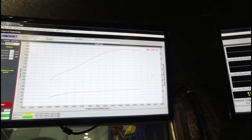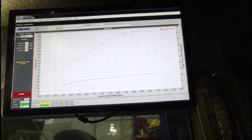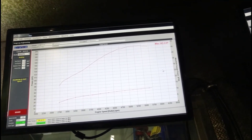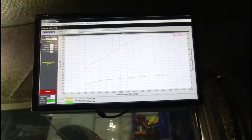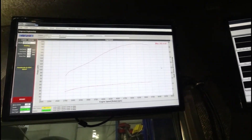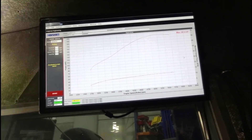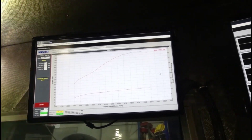I'm going to look at my logs now — checking how my ignition timing is going and how my injector duty is going. I've got 600cc injectors, which should allow me plenty of power headroom. I should be somewhere around 50% duty at this point, so I've got plenty of injector capacity left. Overall I am happy with this start.